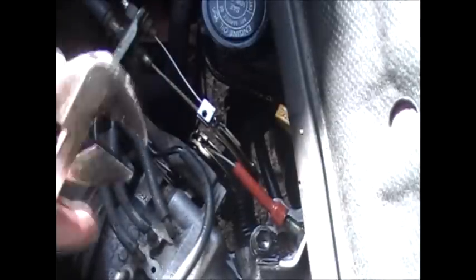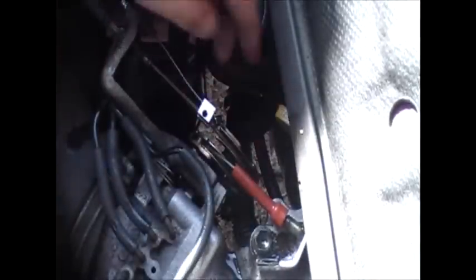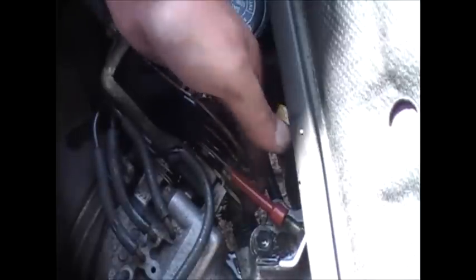This is a little bit loose here now, so if I give that full throttle, full acceleration rather, throttles on a motorbike, I've got a lot of slack there, so I want to try and tighten that up a bit. I slacked it off a long time ago to what it is now because of the problem. I didn't realise that it just needed a little bit of a fix. Geez, an open end spanner would have been much better for this. Anyway,